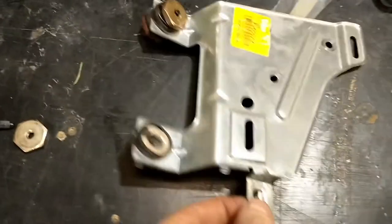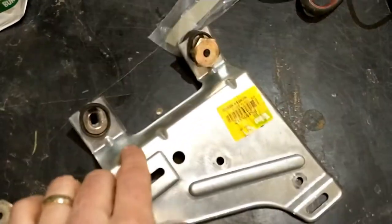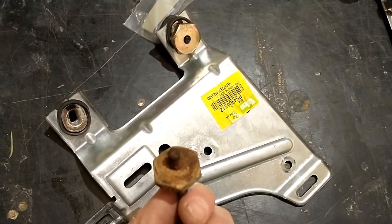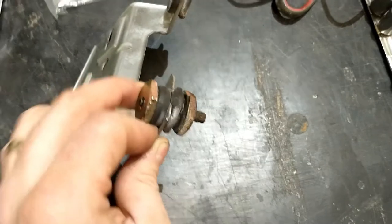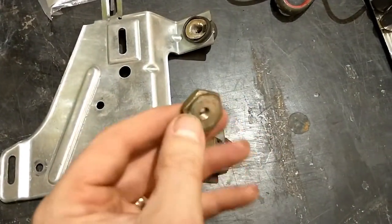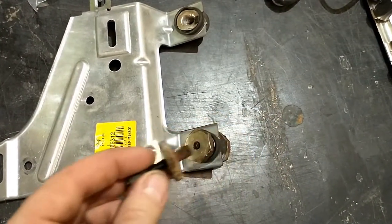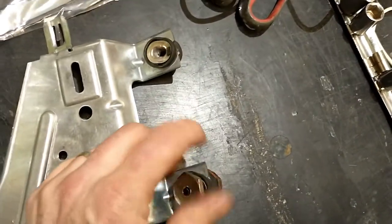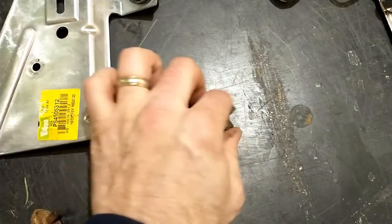I have the bracket off the car. This little tab right there gets bent up and it'll slide off of the wiper motor. Once you have it off, these studs were originally permanently attached to what is now just a pile of rust. It operated like this — a stud was welded onto that, I assume. And then this very large nut kind of kept it on there. There's one on the other side — pretty well demolished. I'm not going to try to save that; it's really not worth the time. You just need a wrench to get those started, and once you get those started, it comes apart and now you have that.